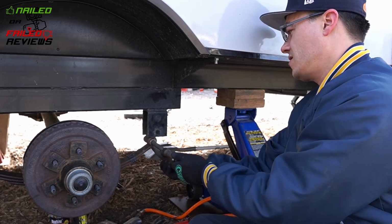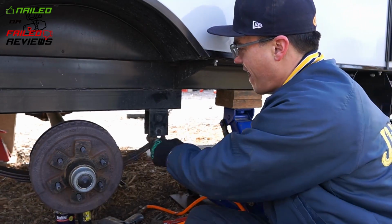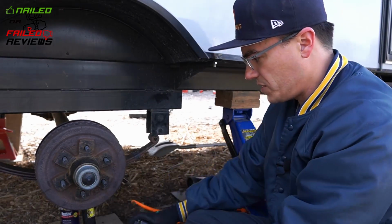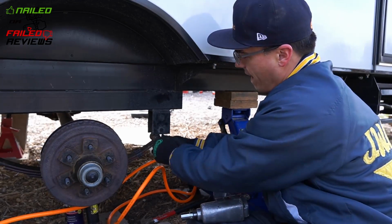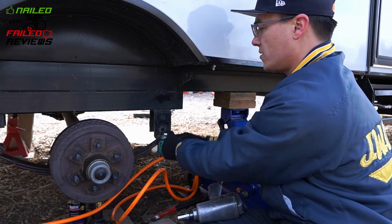And then when I put the bolt through, it actually was kind of tight, but it was just deceiving because of how tight the actual spring hole was. And then once I worked it a little bit with the bracket and the bolt, it worked free, and then once I actually put grease into it, it felt much better. So just be aware, you might run into something like that.